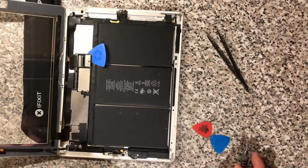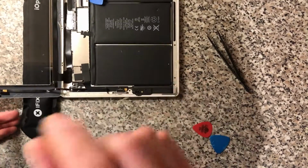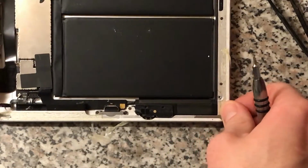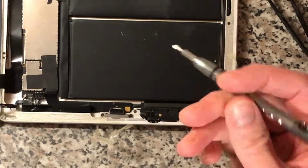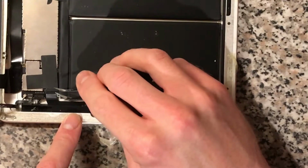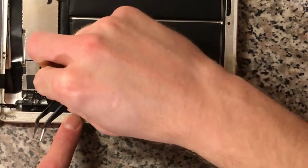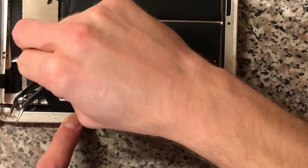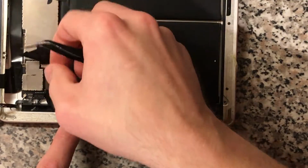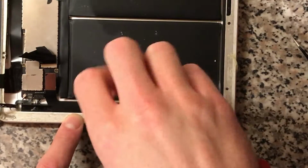So that's one thing. Now we need to get this boy out. Let's just zoom you in a bit. There we go. Wonderful iPhone 7 Plus with zoomable functionality. So we're just going to take this out, the old charger port. It worked some ways. Like if you put the charger in one way it worked, but if you put the charger in the other way it didn't work. So we just unplug that and then unscrew these screws here.